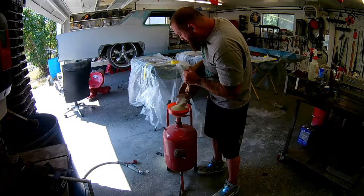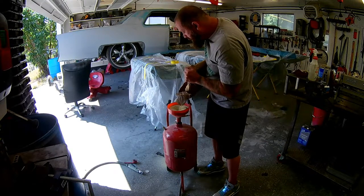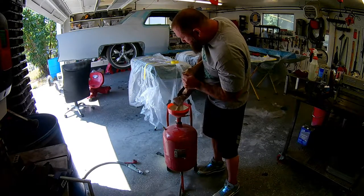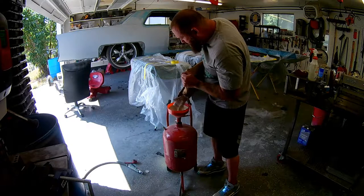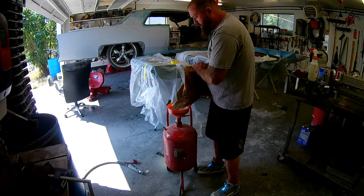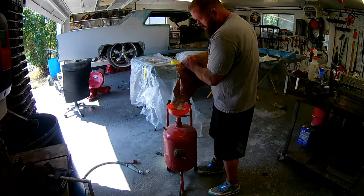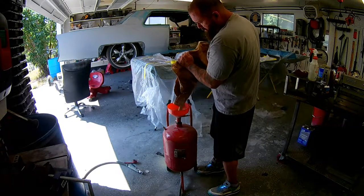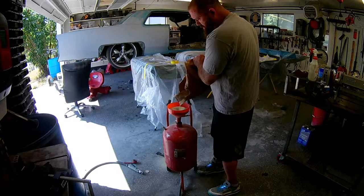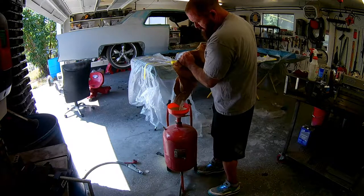As you can see here, it takes a little bit to fill up this 40-pound pressure tank. The other thing I did was I bought the good dead man switch — or dead man valve — laying down there on the floor. That really helps. It comes with a really cheesy ball valve that will eventually get worn out by the abrasive going through and blow a hole in the side. I probably went through four 3/8 ball valves and finally broke down and got this dead man's valve. It's pretty good quality.